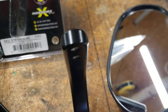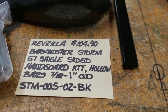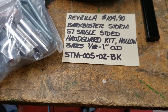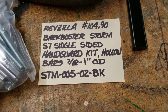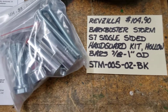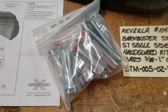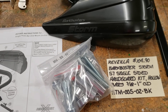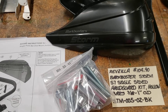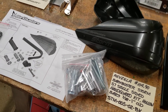You can see here their aluminum backbone is solid — it looks to be about three-quarters wide by about three-eighths thick. These came from Revzilla and you can see the part number, the bag full of hardware with the inside mount. This is really great for limited handlebar space for those of us that have winches or handlebar heaters, stuff like that. These are Bark Buster Storm.